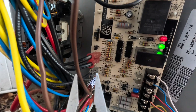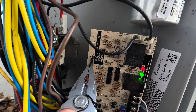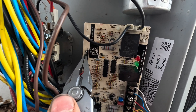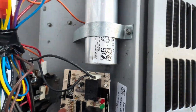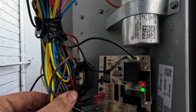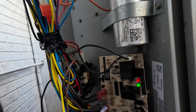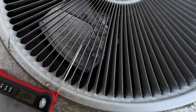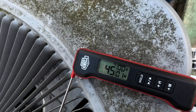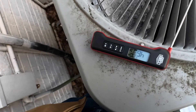Let's go for a defrost cycle, see if she's going to defrost this time. Put it back on 90. She would not stay in defrost last time — it would switch over and switch right back. The sensor was closed; I even jumped it out and it did the same thing, in case you were wondering if I just had an open defrost sensor — I did not. There she goes. You can see that temperature rise. Defrosted nicely — temperature rising just from the radiant heat coming off that coil.